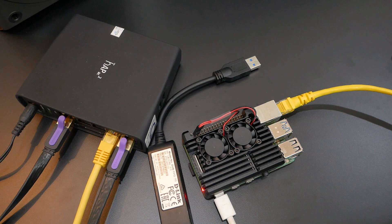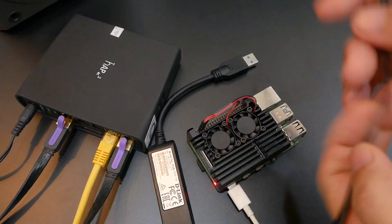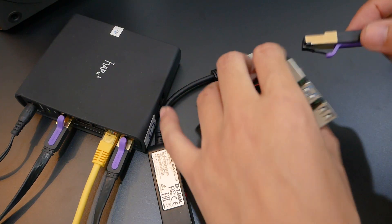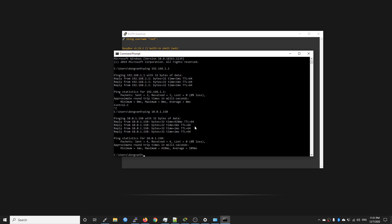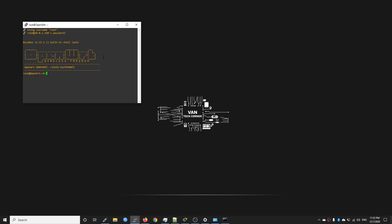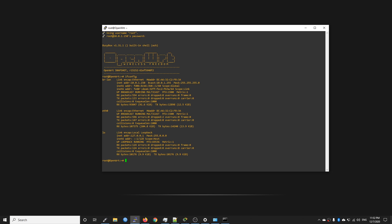The Raspberry Pi 4 should now be running with IP address 10.0.1.150. Connect the Raspberry Pi 4 to the MikroTik router via the LAN port. Ping 10.0.1.150 — we get a response. Establish the SSH connection, enter the password, and run ifconfig — the LAN interface shows 10.0.1.150. Let's check internet connectivity: ping google.com.